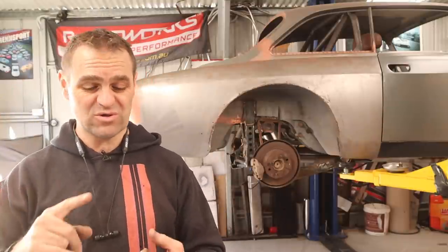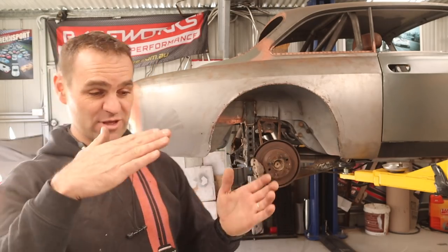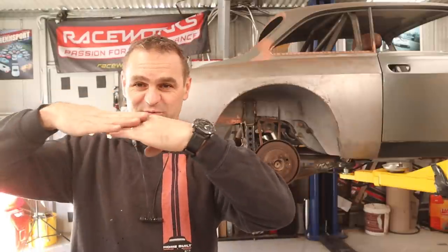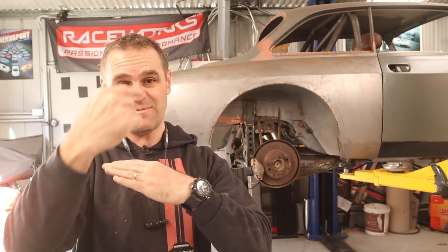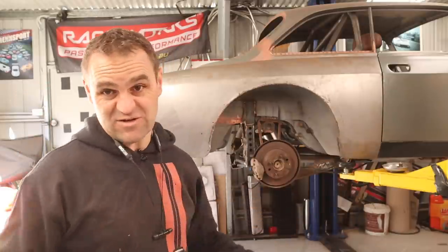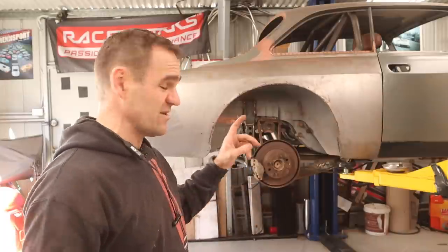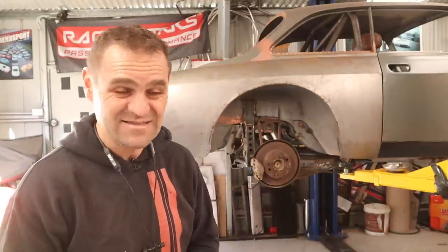There were lots of comments about the exhaust - one of the big ones was the exhaust hangers. I agree the exhaust hangers are very short. There was absolutely no way I was bending that stainless steel rod. Normally you would have the rod welded flat onto the exhaust pipe, bend it up into a hanger, but it was far too stiff for that. Look, yes it can definitely pull out and crack and create issues, but if it does it's a five minute fix on the hoist. We are welding stainless onto stainless, not mild steel, so it should last a lot better. I'm happy enough with it as it is for the time being.